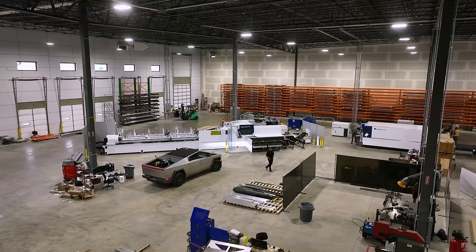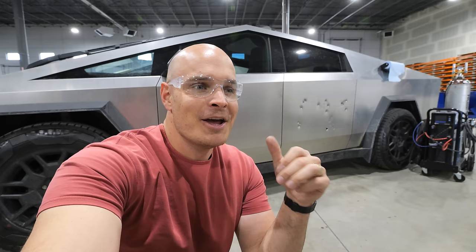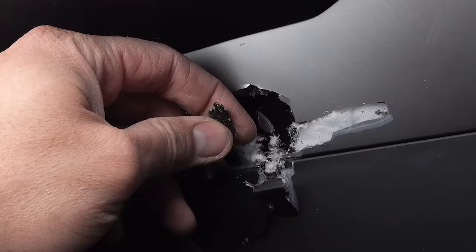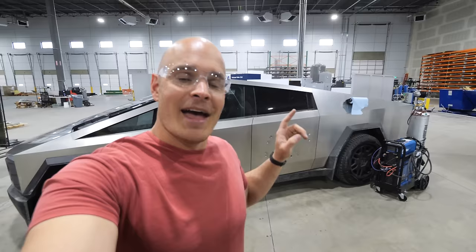Since there is no paint or primer or anything else, we should just be able to weld stainless sheets right onto the stainless steel body using a welder powered by the Cybertruck's battery. One thing I did notice after shooting the Cybertruck is that all the exterior buttons worked and all the buttons inside the cab, but the only buttons that did not work were the buttons inside of the door. The .50 cal bullet ripped through one of the indoor wiring harnesses — pointed out by Wes, one of the Tesla engineers on Twitter, which is fantastic customer service. I'm going to try to splice that wiring harness back together to get the interior buttons working.